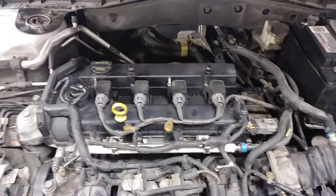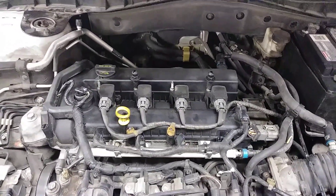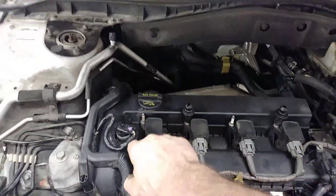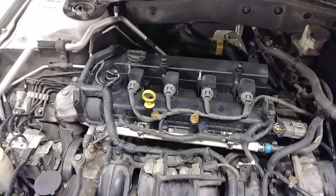I gradually ground off that lip until it was pretty much smooth all the way up and down, just like the Fusion. Then the seal went in fairly easy. I put RTV on the inside of the grommet and pushed it into place like it was in the Fusion valve cover, then smeared a little around the outside gap, filled it with RTV, let it sit and dry — and it should be good to go.